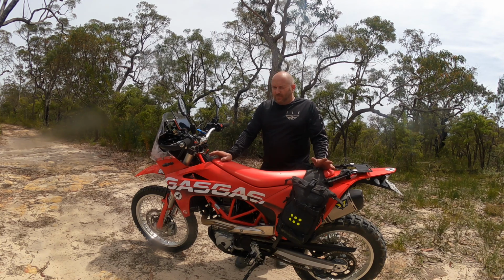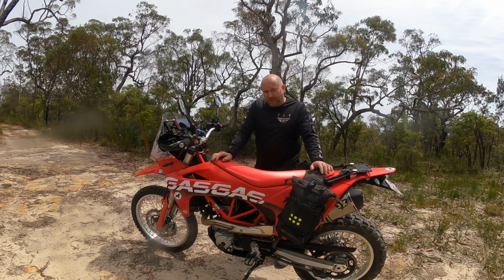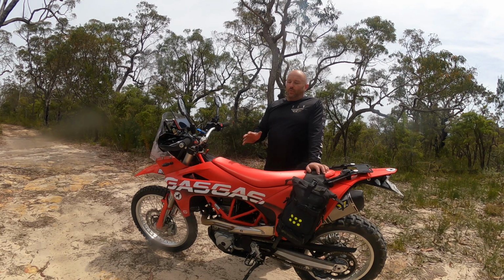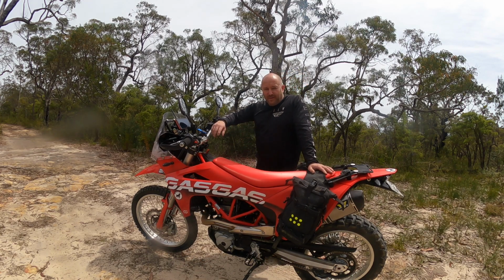Be realistic when you do go and get your suspension done. Everybody wants to lie about the scales, but if you want the bike to handle properly, be realistic. I'm 95 kilos, and with all your gear, just for a day trip, backpack, boots, pants, jacket, helmet, you're gonna be upwards of 105 kilos. So when you look at the bikes coming standard rated for 70 to 75 kilos, you can see why upgrading the springs is almost a must.